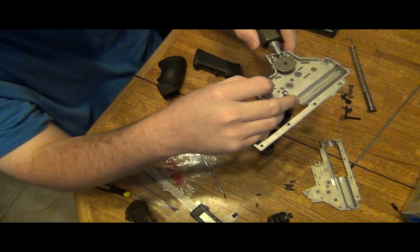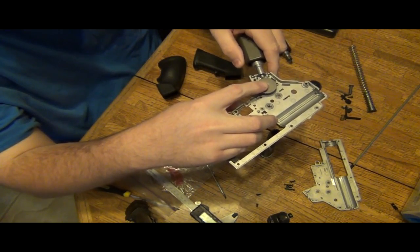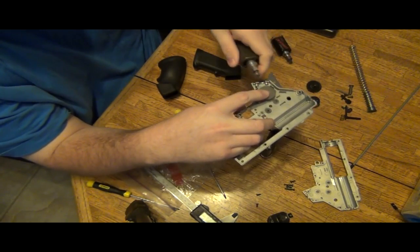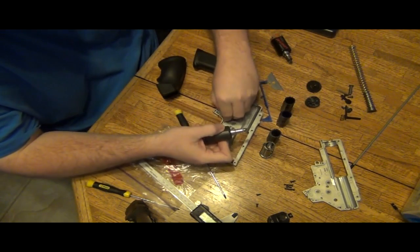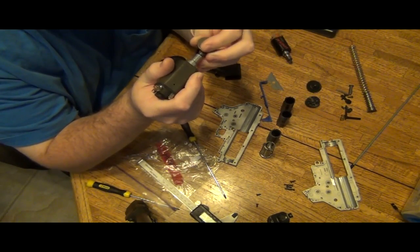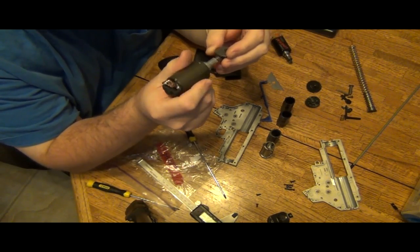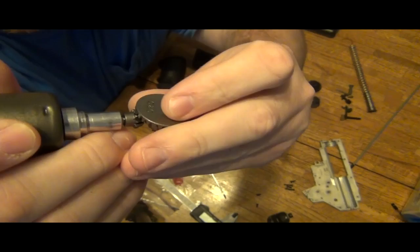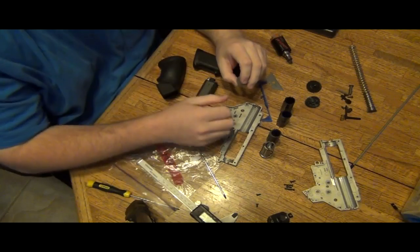But what they'll do is, as an example, just put shims only on the top of this bevel. So they'll leave the rest looseness. So when this comes in, this pushes it up. And what that really does is it kind of angles the pinion to the bevel like this, and it gives it a little bit of a different noise as you shoot it. The reason for that being is because of the angle. You can kind of see here and kind of see here that the angle would be a little bit different coming in. However, that's not the proper way to shim it.